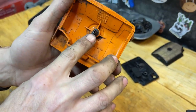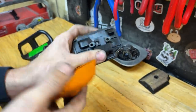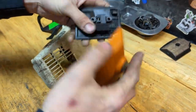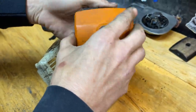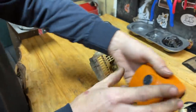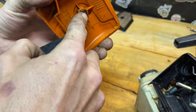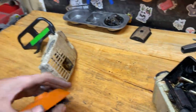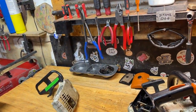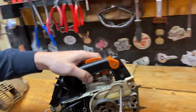Here's another common part to watch for — this is the twist lock. It's a metal lock and a post in the middle. You always have to keep an eye on the condition of these. If you have any trouble locking the filter on, if this is hard to lock or it's bent, do not bend it back — replace it. Because when this sits on your saw, I've seen this about a dozen times: this post will either bust loose or one of these tabs will bust off and go directly into your cylinder — instantly destroyed. It's kind of a design flaw.